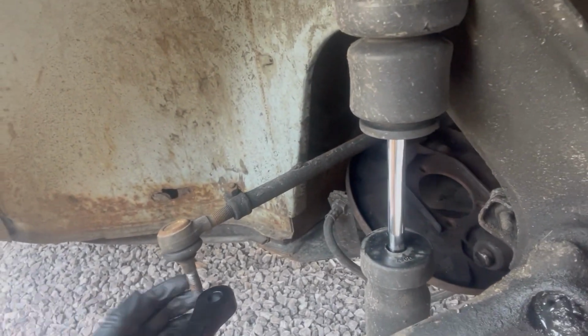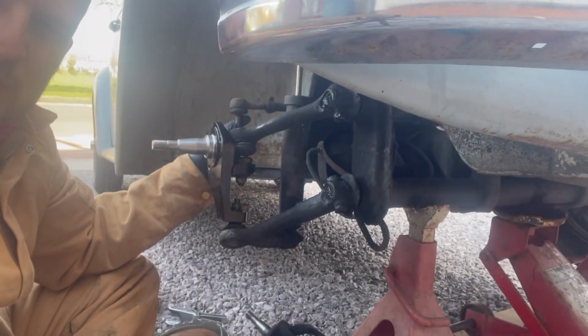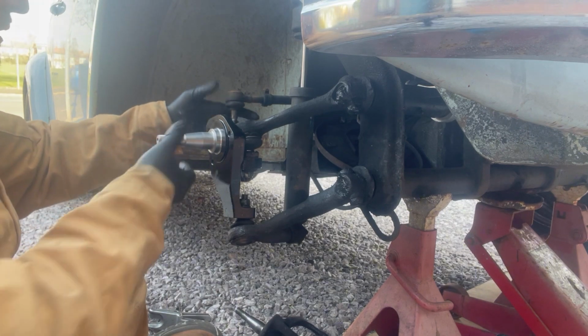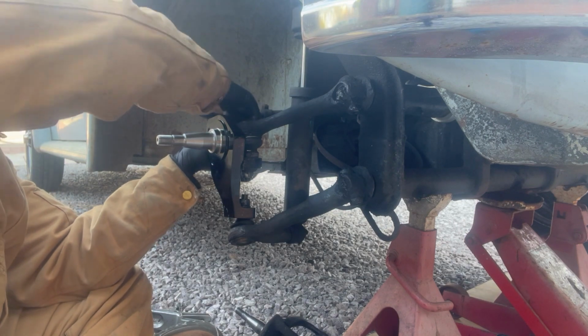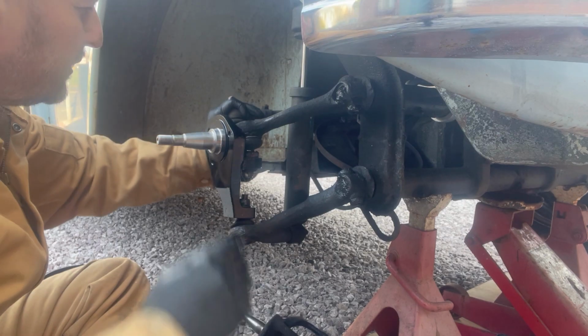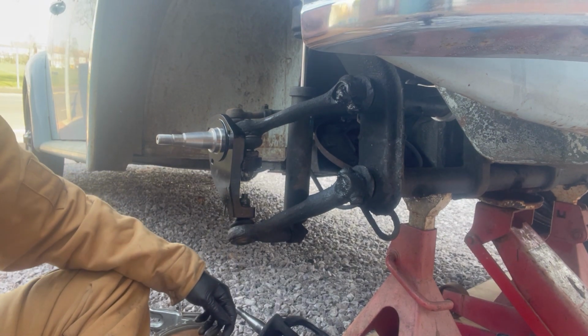These are tapered the regular way up. Sometimes if you're going really slammed, what you might find is that this starts to catch here, and if your car's super slammed, which this one was never, to be fair, super slammed, but if it's pretty low, then you might need to reverse taper or put a reverse taper bush into the tie rod so that you can basically flip the tie rod upside down, so that the tie rod fits in from the bottom, and that just gives you a little bit more clearance of the wing.